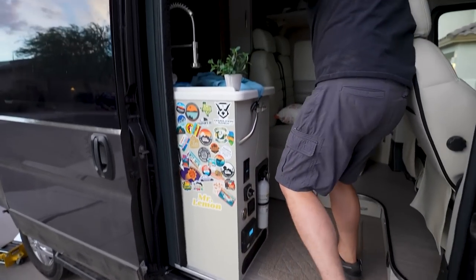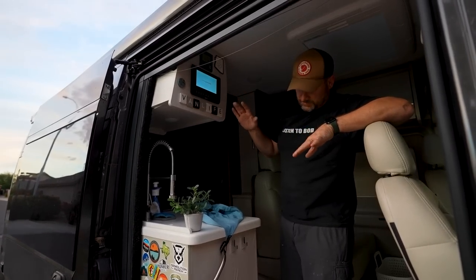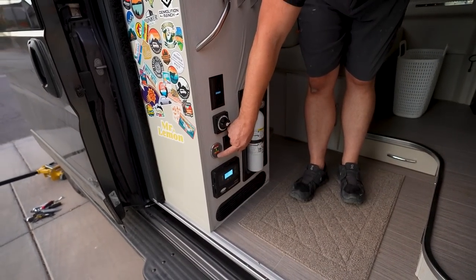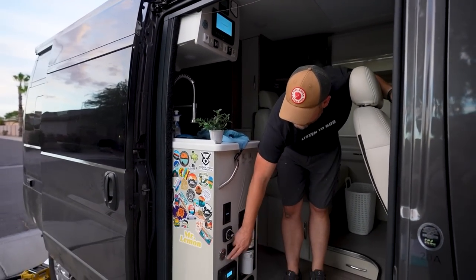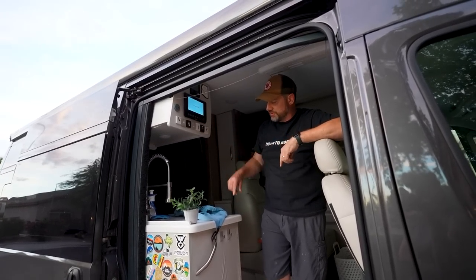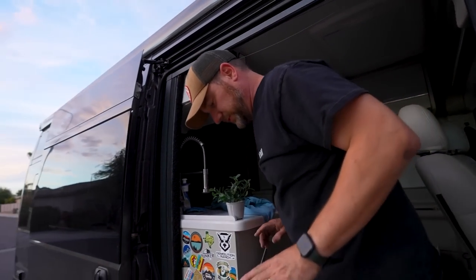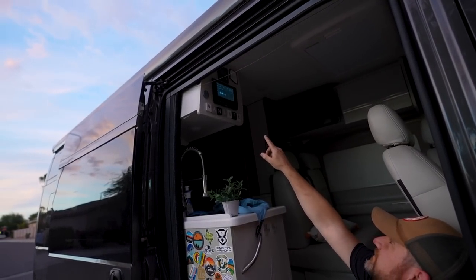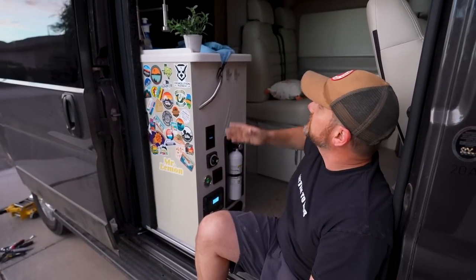It's initializing. They match — that's saying 13 volts. Let's wait for the BM Pro to kick on. That's good news that it clicked on. The fact that we've got power and things are running right now is very good because before, even after a couple of minutes, this would go right to an error. This may need to be reset or reestablished in terms of what's 100%, but I'm waiting for the BM Pro to kick on. That actually looks correct — that is saying 12.9 volts is the coach. Our solar charger is saying 13 volts, so that seems correct.